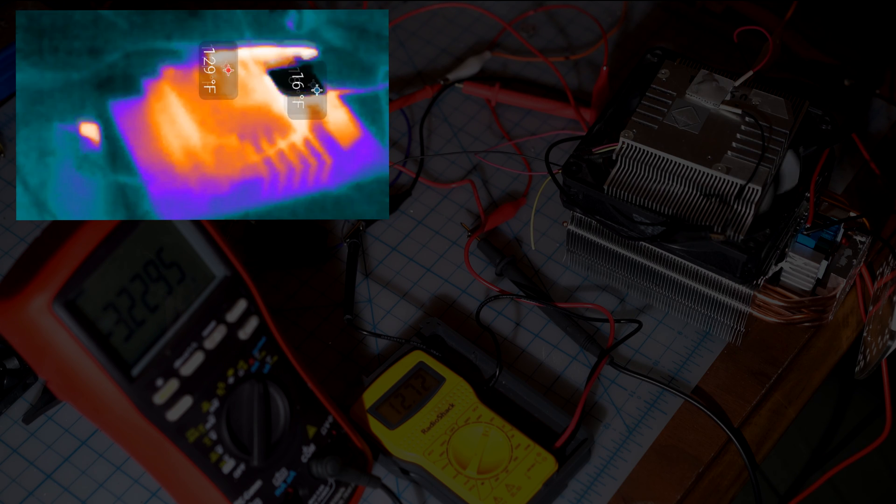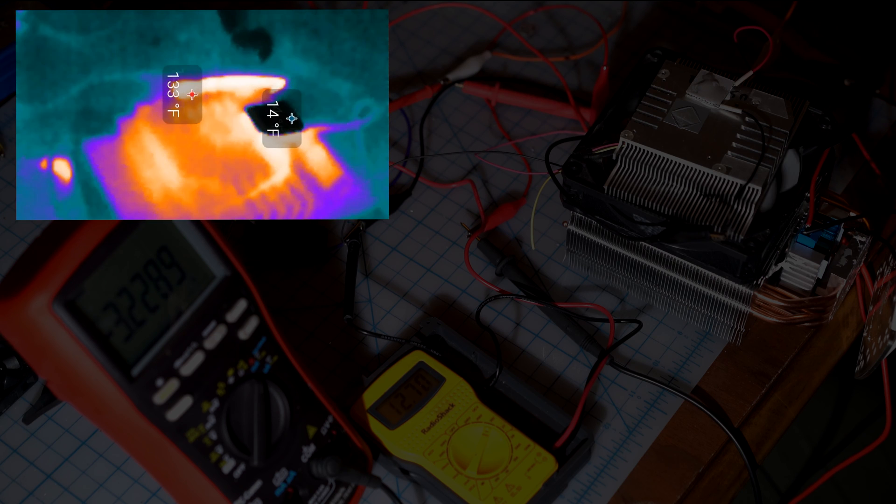This is the problem using it for a CPU — cold air doesn't hold water, so you get a lot of condensation. All that hot air around there and the air that's getting freezing cold expels the water and it freezes. So you really don't want that moisture inside your computer — it's not a really good practical long-term solution to use a Peltier, unless you had some kind of enclosure, or bodied it within a water cooler. But just the power usage is absurd — you can see I'm using 3.2 amps at 12.7 volts. That's ridiculous.